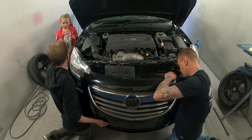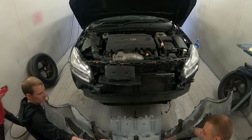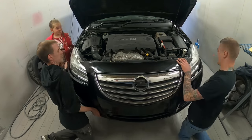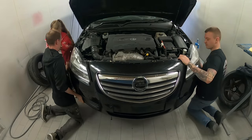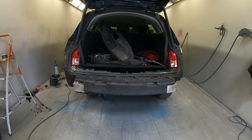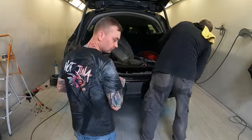As you can see on this panel here I'm working one way and then the opposite way, doing this four or five times and working section by section so I'm never overworking a giant area. These DA polishers are really good at putting next to no heat into a panel, so it doesn't matter if you work a section for quite a lot of time. Once all that was done, we got the freshly painted and rebuilt front bumper back on the car and started getting it rebuilt. My little helper was with me on Saturday morning as we were trying to get the last odds and ends done.